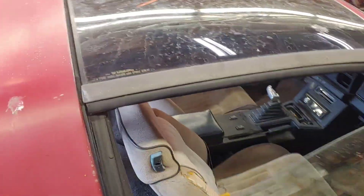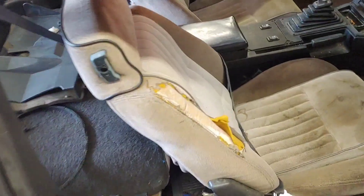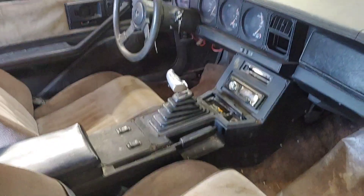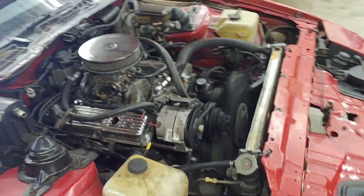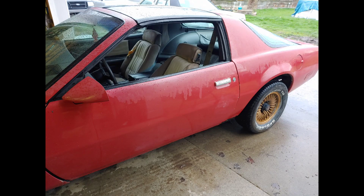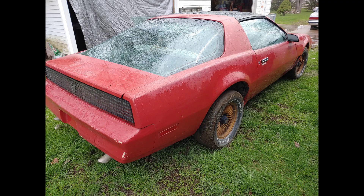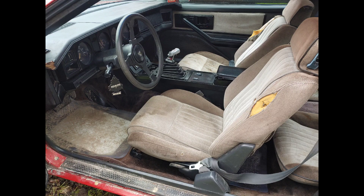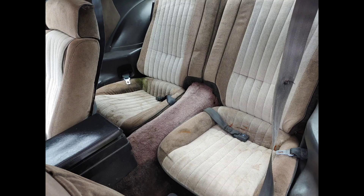Towed it home and pushed it into the garage, just to find out that the distributor cap had water gotten underneath it. I didn't see any cracks or anything like that — maybe it wasn't all the way down, the screws holding it were kind of weird. I ended up blowing all that out, drying it up, and the car fired right up. Power washed it really good.